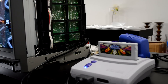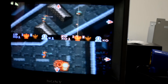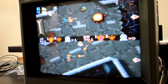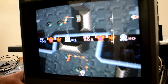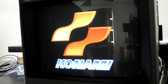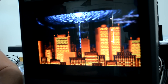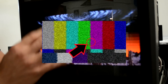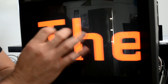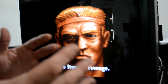Looks like we have a successfully completed job. I've got it hooked up with the Super Nintendo and the screen just looks fantastic. I've power-cycled it a few times, and it has been running for about the past 45 minutes straight just to make sure it's warmed up. Everything works perfectly now — this monitor has had a complete recap of the power supply and the geometry caps and is in good shape for the next 20 years. If you have any troubles with power in your PVM — whether it's a wavy screen, a throbbing screen, or jittery sides that don't stay stable — check out your power supply. There's a good chance it needs either a component or most likely the capacitors replaced.